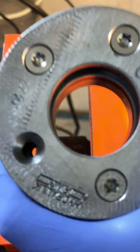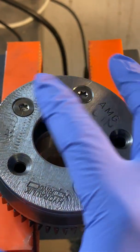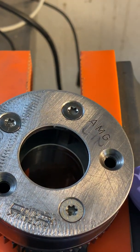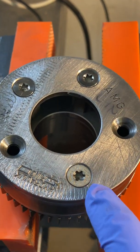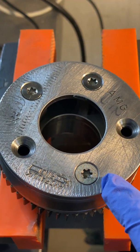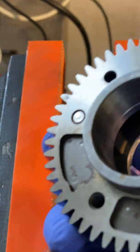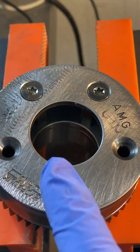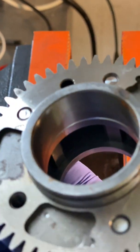A quick test on titanium bolts. One of these bolts — out of three — has been over-torqued, and we're trying to compare at what value that happens. All three of these are torqued at 18 newton meters — not foot pounds, 18. This is the stock one. I will not say which one was over-torqued at this time, but I'll show you the back so you can see the clearance on them.